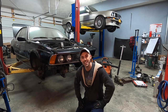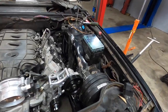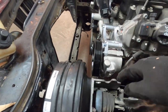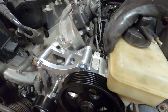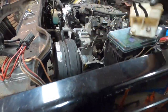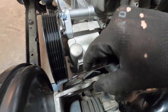Installing the engine is not as easy as you think. Power steering pump is installed, and you can see the clearances are not bad, actually. You can easily get your finger in there on all sides. Clearance to the booster is good; clearance to the bracket is good. Unfortunately, the booster will not fit in the stock location — it is really, really close to the reservoir and the pulley. Instead, we're gonna mount it right down here next to the fuse box. We'll end up fabricating and welding a bracket that allows you to install and remove it easily, just like you normally would.